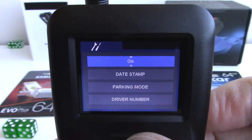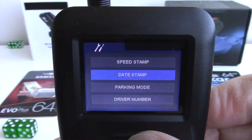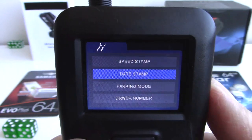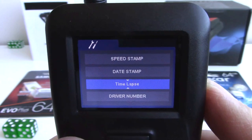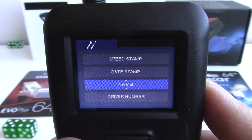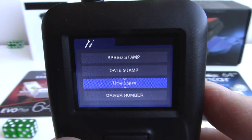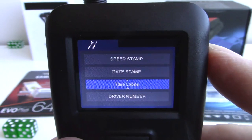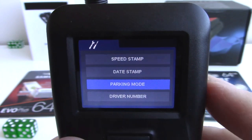Not everyone wants the speed stamp shown in their video. For my demonstration, I'll leave it on. Parking mode I'm going to cover in my next video. Time-lapse is 1 frame per second. Normal is 30 frames per second only during an impact or G-sensor event. So leave it for normal to reduce the clips that are recorded.